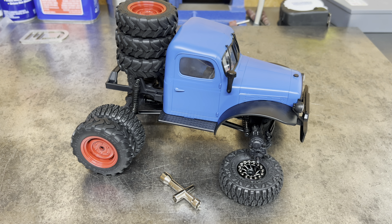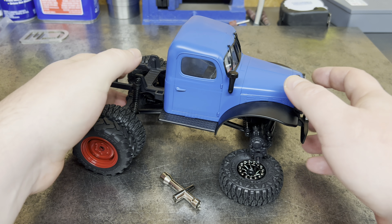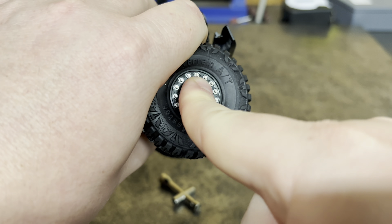This is a time you can be impatient — we can make a quick fix and get them on there. We'll get these tires off. All you have to do is flip the nut over, push down on it a little bit with your finger, twist it a couple times, get that Nylok started, and then bring your wrench in and keep tightening this thing down for the 1,400 threads that it has. The more the merrier. We'll tighten this guy down.